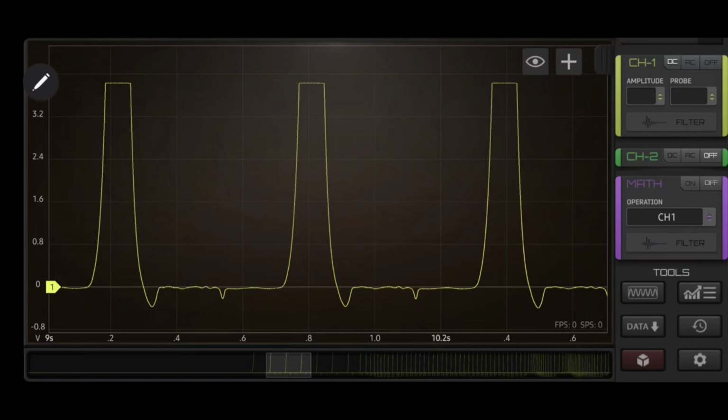The difference is when you do a cranking in cylinder pressure waveform, you have to do it with the throttle plate shut. You cannot do it with a wide open or clear flood crank. You have to disable ignition, which I recommend, and then crank the engine over that way. You cannot hold the gas pedal down, because it actually deforms your waveform. If you see that and don't know the difference, you're going to say, well, we have no intake valve, no intake right there.